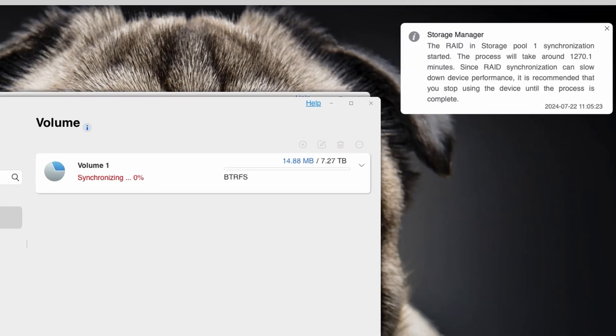What does T-RAID mean in real-world terms? You can add more drives at any time and the NAS will expand your storage volume to give you the best combination of usable storage space and redundancy. You can replace individual drives with larger drives as your needs grow, and you'll always be protected against the maximum of one drive failing provided you install at least two drives. For users on a budget you can actually start with one drive and add a second for redundancy later — though of course you won't be protected against drive failure with only one drive installed. Bear in mind that large RAID arrays take a long time to synchronize: our 8 terabyte RAID would take about 1270 minutes, or 21 hours, and each time you swap a disk or upgrade the array it needs to synchronize. T-RAID is a nice idea especially for non tech savvy users but also for those who are tech savvy but time limited, with the caveat that I haven't tested this over a long period of time yet.